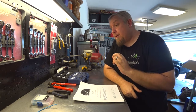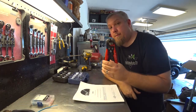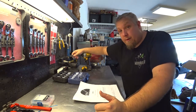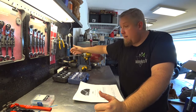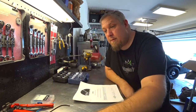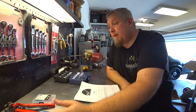After that, you'll need your standard wiring stuff. Wire cutters, some wire strippers, or you can use wire cutters and just trim them off and go from there. If you want to mount the switch, use a paddle bit or drill bit and a drill, and some different color wires to extend your wires, like so. The more different colors that you have, the better off you are. If you can match up the colors from your gauge cluster, the better off.